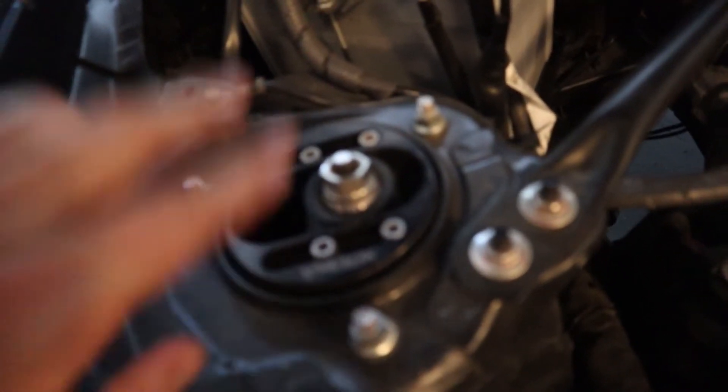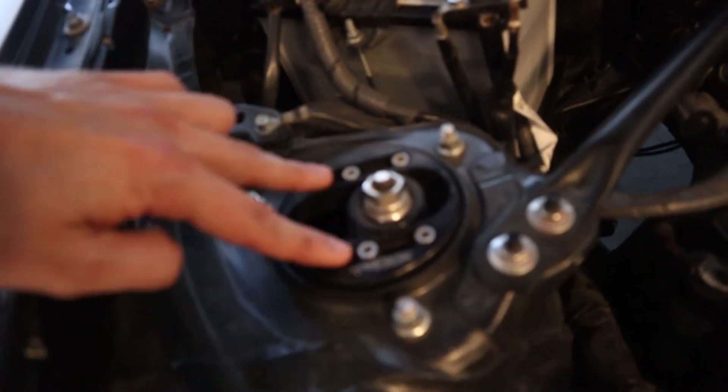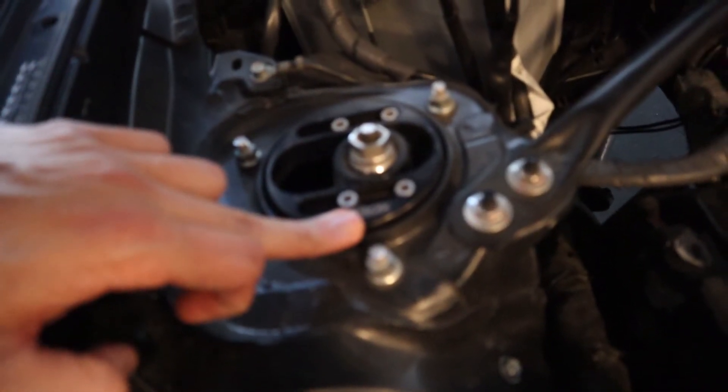What I was trying to explain is that it looks like an aftermarket coilover with what's called a camber plate. Here at the top of the coilover — your shock absorber — you can see it has some left-to-right camber adjustability. These are Velox top hats. Essentially, you can get top hats that give you camber adjustability, making your wheel go from straight up and down to an angle. These camber plates give you that angle adjustability, but they won't give you compression or dampening adjustment like a higher-end coilover system would.